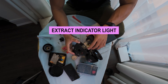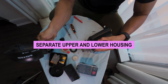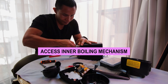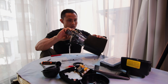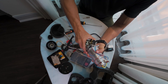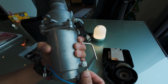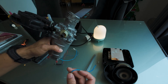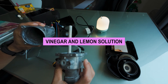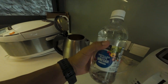Using a screwdriver, press on the lock and unlock hole inside the activation dial, align with the coffee mug symbol to detach it. Gently pry out the indicator light from its housing. Carefully separate the upper and lower housing components. Unscrew any remaining screws inside the machine to facilitate removal of the internal boiling metal component. Unplug any electrical connections you encounter, ensuring you carefully note their positions for reassembly. Once all components are disassembled — particularly the boiling water housings and the steam spout sleeve — immerse them in a vinegar water solution.